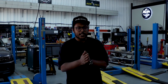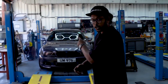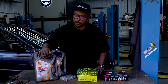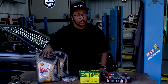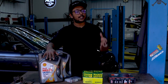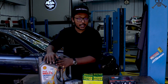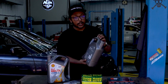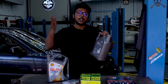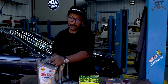The car is on the lift now. Before we start working, we're going to check out the consumables we're going to change. First, we're starting with the oil — I got a Shell Helix Ultra 5W-40. Before picking oil, check the temperature you'll be driving in. For colder climates, a 0W-30 in Mobil 1 is recommended. Also, check that the oil has the BMW LL01 — BMW Long Life 01 — rating, which is recommended for the M54 engine in most E46s.